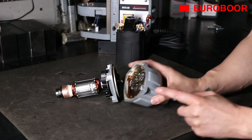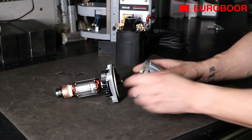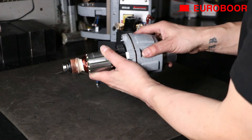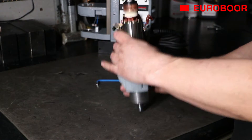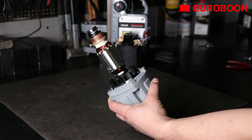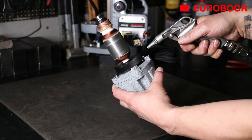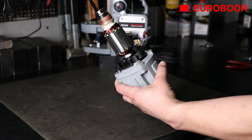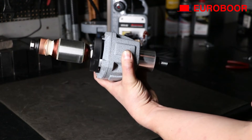Align the inner gear plate with the armature installed to the gearbox — note the protrusion shown in the video for proper alignment. Give it a careful slam to fasten it, but be careful not to use the armature's end to do so. Check if the armature is properly installed into the gearbox by spinning it hard with an air pressure tool or manually with a wrench. No noise from the armature while spinning means it's installed correctly.